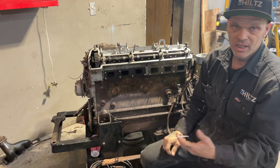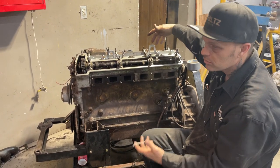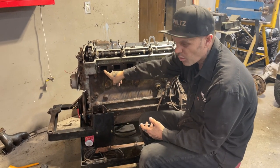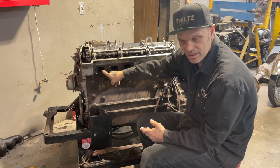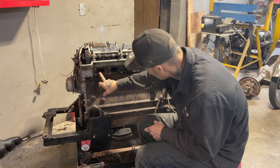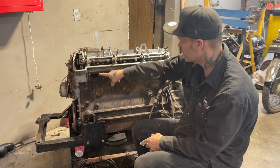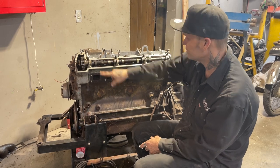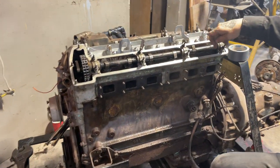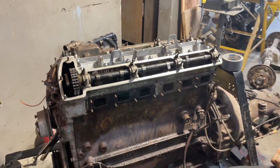Well, I got anxious when I put that in there. I knew that was fluid in there, and that it would either come out this hole when I turned it over, or it would push it shut. That's basically what I was thinking or hoping. Well, it got hydrolocked, and I'm saying that it pushed that valve shut, because it held transmission fluid in there, and there's still transmission fluid in there. This valve looks like it's up now. All we did is put penetrant inside the valve there and the valve stem, and we kept working it, and it has finally come loose. It has done its job.